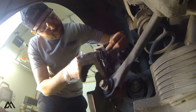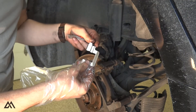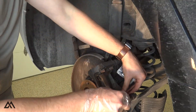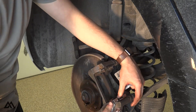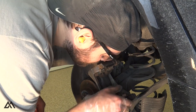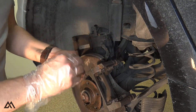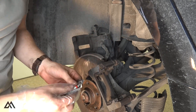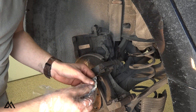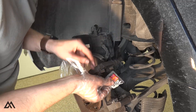These inserts that we've removed and are now reinstalling are the surface on which the pads will slide, so we'll want to make sure they're well lubricated with brake grease. At this point you could also pull the caliper slide pins to grease them up. However, I checked these on the other side and they looked fine — this car is not very old and doesn't have a lot of miles on it, so I skipped this step. But if you're interested, I've linked a video showing that procedure in the description below.